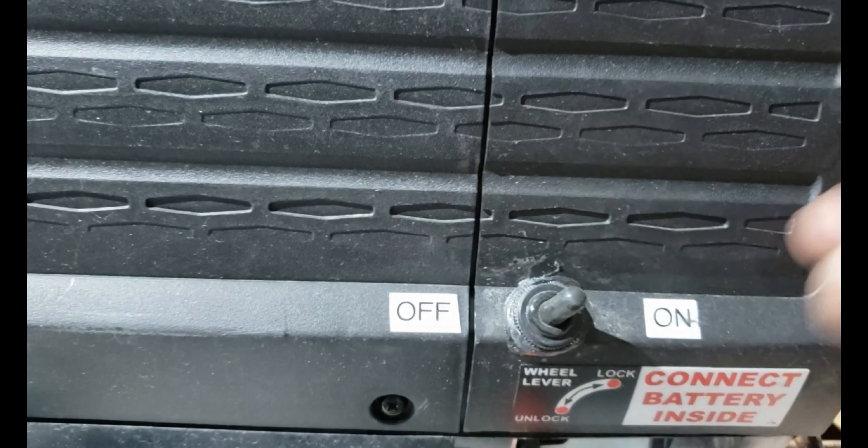About the antenna on the motherboard: if you bend it into an L shape you'll get much better range. I also added a switch to kill power to the motherboard. Battery drainage is minimal, but over one, two, or three months during winter it could drain the battery quite a bit. This switch cuts the ground wire going from the motherboard to the front panel inside, so when it's off there's no power to the motherboard, and when it's on power is reestablished.